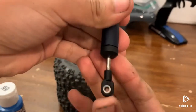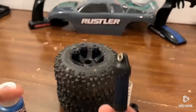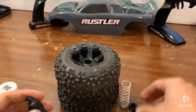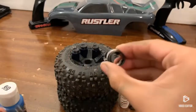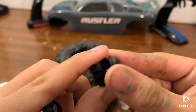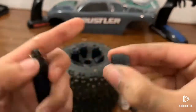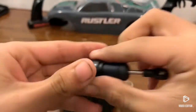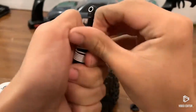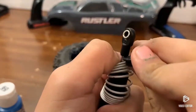Tighten it a little bit more and then your shock should be moving smoothly without the shock spring. From there, grab any stock spacers that were on there, the shock spring perch, and slide it on. Grab your spring, compress it, and add the lower spring perch.